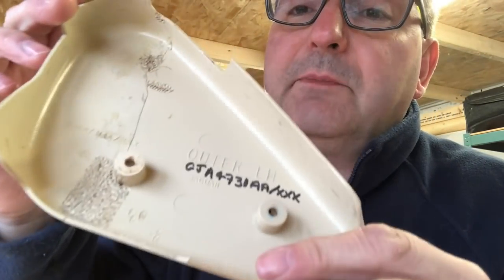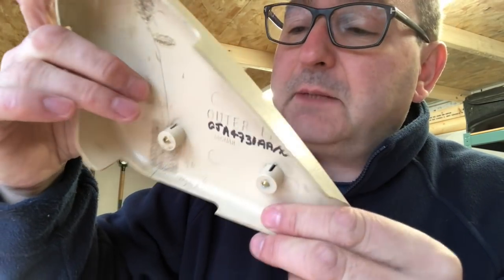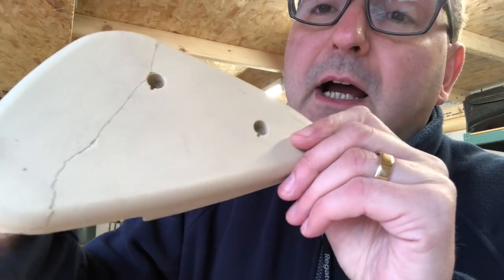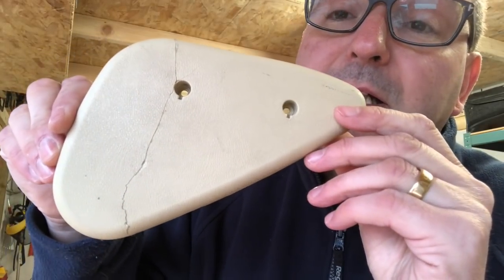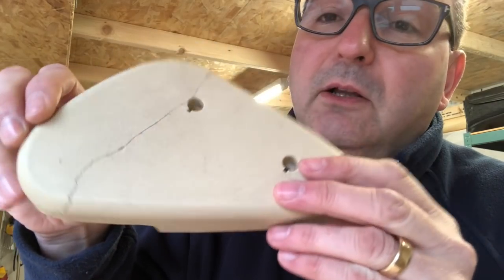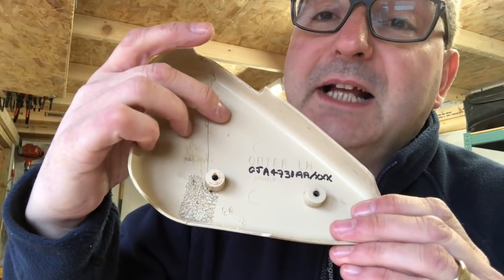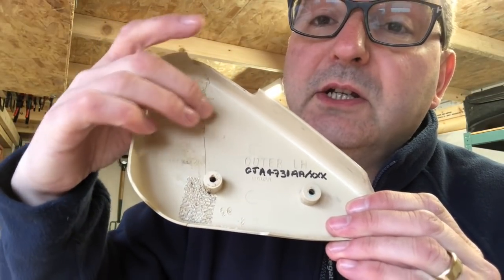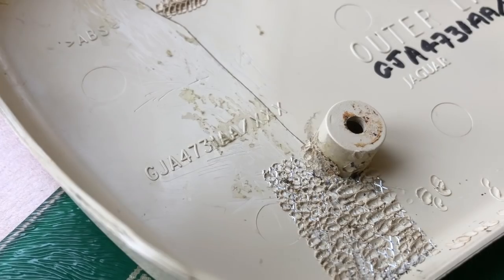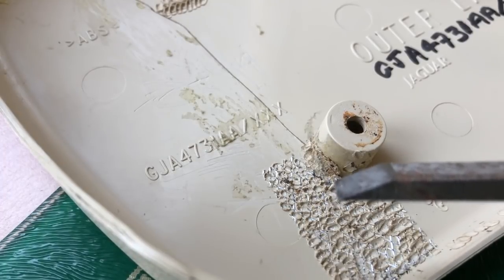With all these techniques I've been sharing with you so far, I've not been going very deep, and that's because I've been trying to preserve the grain on the outside of the panel. If you were doing something more structural or hidden, then obviously you could be a lot more aggressive with your techniques, stitching the plastic just on its own. You could go right through and leave marks and then just sand it off and paint it up and it'd be great.